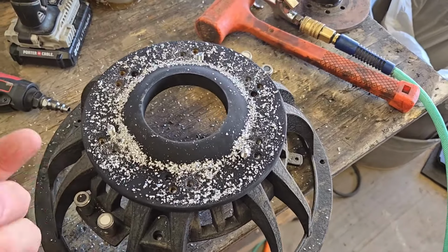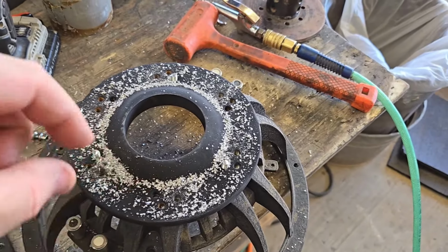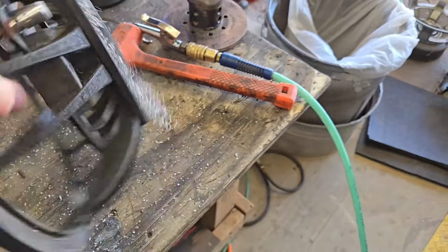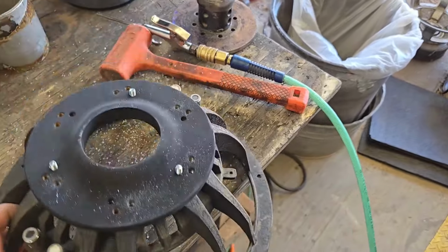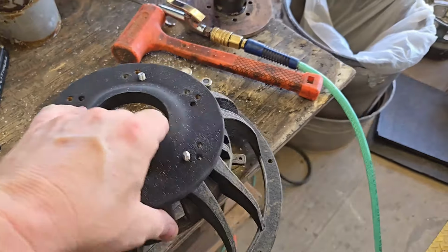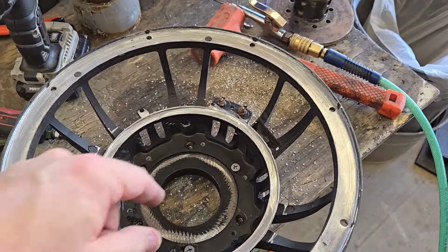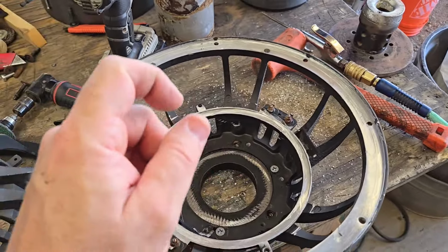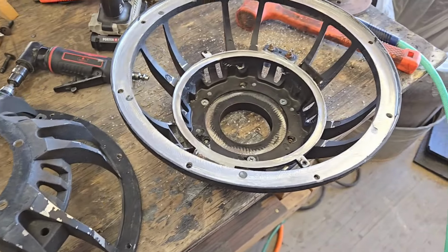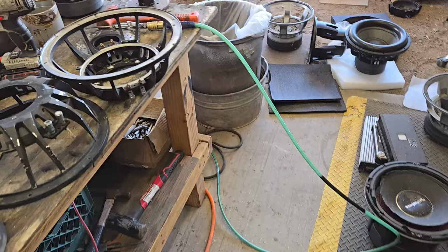This is basically what I did. I went in and then I came back. I think it's with the 3/16, you don't want to mess up the threads too much. You can always go back and tap the threads. But now the 135 bolt hole circle is on there, and then what you want to do is go back and just enlarge it to whatever size you need. We're going to be using M6, so I think we go to like 1/4 inch, something like that. But let me enlarge the holes, and then we'll do a fit test.